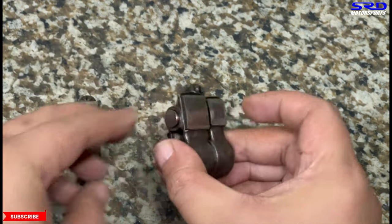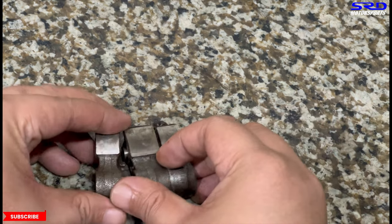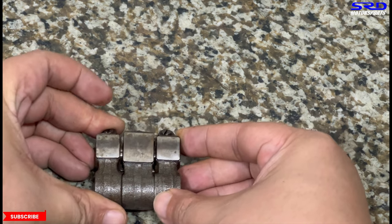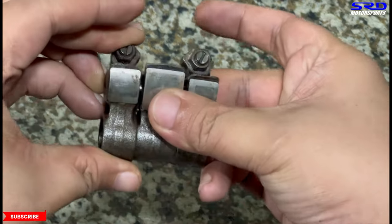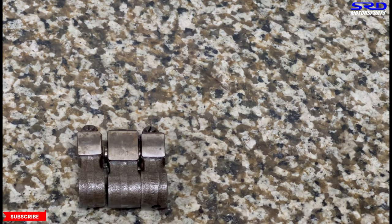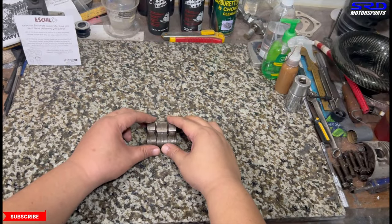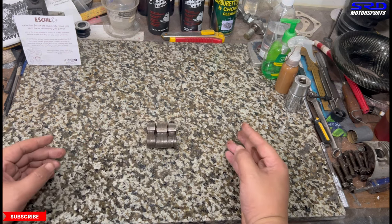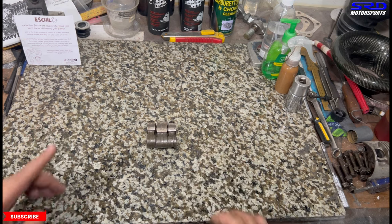Now using the shorter pin here, it sticks out. Put it together and it's locked. You install this with the rocker shaft onto the head — one on the intake and one on the exhaust, ideally on cylinder number one so that you can degree it, clay test it, and even check valve to valve. Once it's laid on the head, you have yourself VTEC locked.